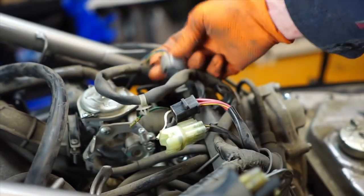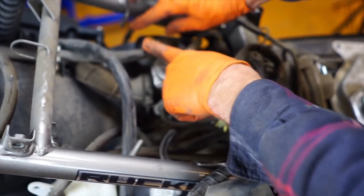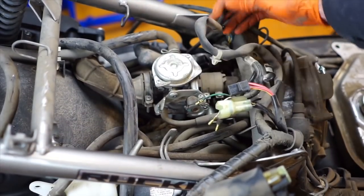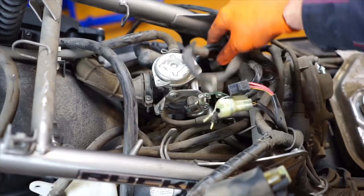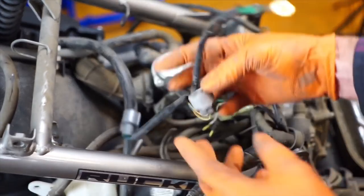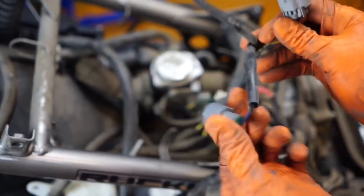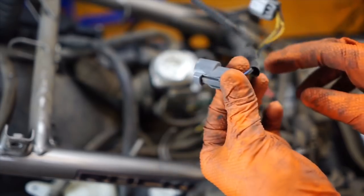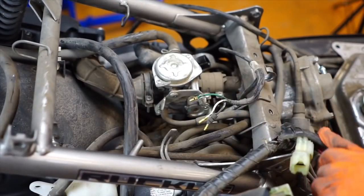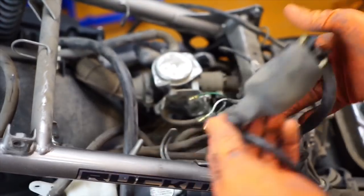I just leave the plug. Then you've got your little choke wire right back here — squeeze the button and give it a little pull. And then up under here, we've got the green ground wire that we unhooked with the brake cable. Throttle position sensor — not using that. Choke connector — we will be using that. Ground — we're using that. Pretty much we've got our complete wiring harness to the motor unplugged.